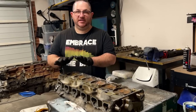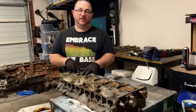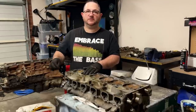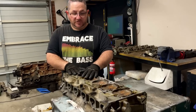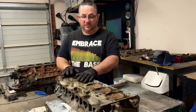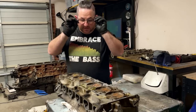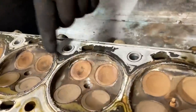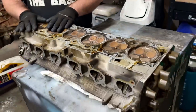Some of the misinformation out there is that a gas motor will have the same exhaust valves that a turbo engine will have. They are the same size valves, but the turbo engine will have Inconel valves. Inconel material will withstand greater temperatures which are induced by the turbo. One thing I read was that gas motors have Inconel valves. Atomic Performance did a video showing the difference - the turbo valves have an O forged into the Inconel, and if we get a close-up of these exhaust valves, you can see there is no O forged into them. I'll leave a link to Atomic's video in the description.